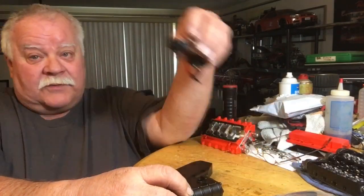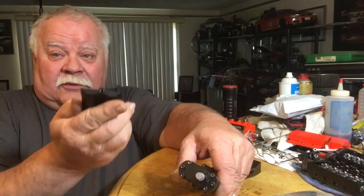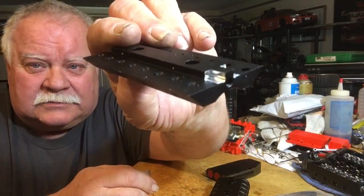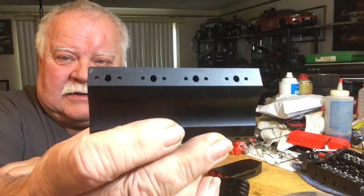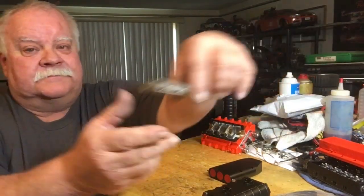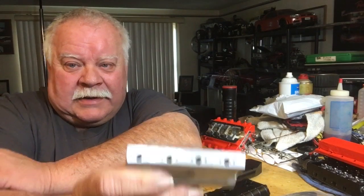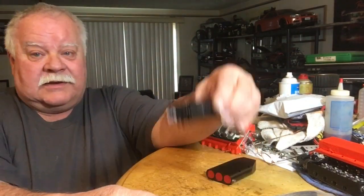So I'm going to show you what comes in the kit. You're going to have to reuse your carbs because they don't come in the kit. However, you get a new intake manifold — the intake manifold is machined on both sides for the supercharger to bolt on. It still has those really tiny ports. I ported my intake manifold to four millimeters and made these bigger because it was naturally aspirated. So now we have force coming into this. It comes with your intake and your supercharger.